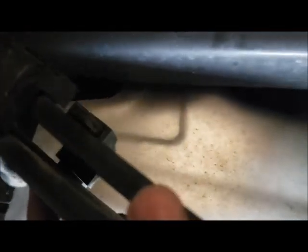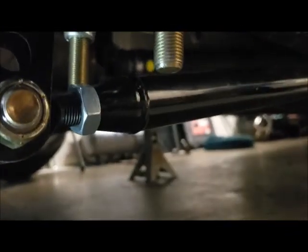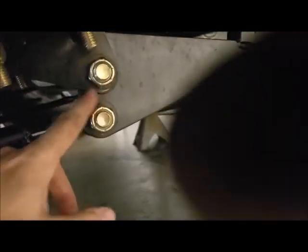Tapping with a little hammer and it'll fall right off, leaving a little nipple or locating pin exposed. That's what you use for this piece to line it up. Here's the back — we did it all at one time while doing the flip kit. Then your bracket piece — I double-nutted this just to be safe. After you drive it around for a little bit you want to retighten everything back up. The reason I chose this kit is because I can just undo these bolts, come over and undo these bolts, and just take it all off.